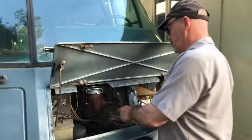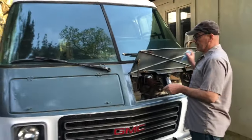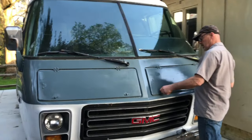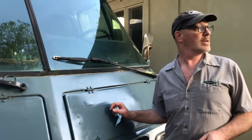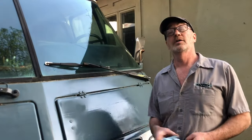The whole time I was messing with this it's because when I put the aluminum intake on I used silicone instead of the rubber gasket. I'm sure that I must have moved it slightly and created a hole in the front and the back. So the lesson is: use those rubber gaskets — the Felpro gaskets I showed you. The next episode we're going to put air conditioning in this. See you next time.